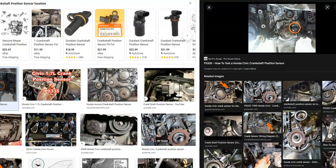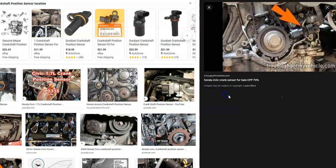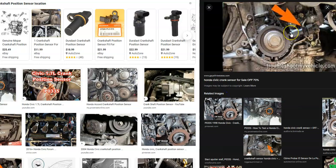There are two main causes: it's going to be either the sensor or the wiring, and this is going to be the second sensor. Most Hondas have one crankshaft position sensor, but this one has two. You have to Google your particular engine to know exactly where the sensors are located, but they'll usually be down on the bottom around the crankshaft somewhere.